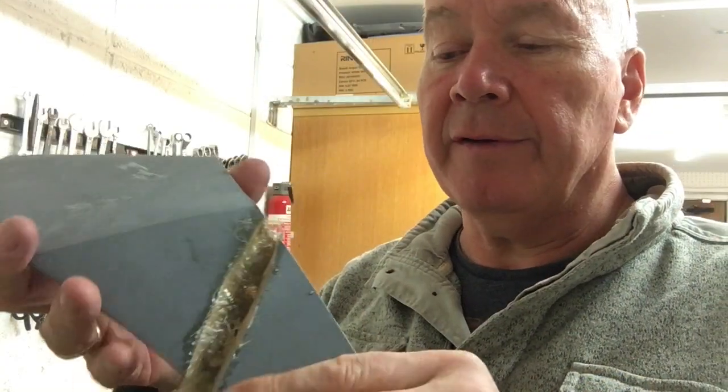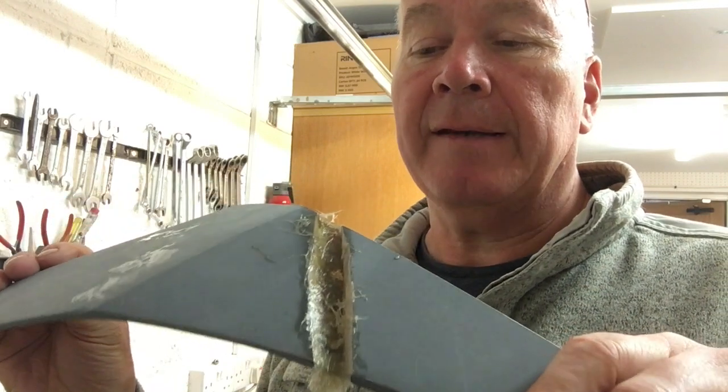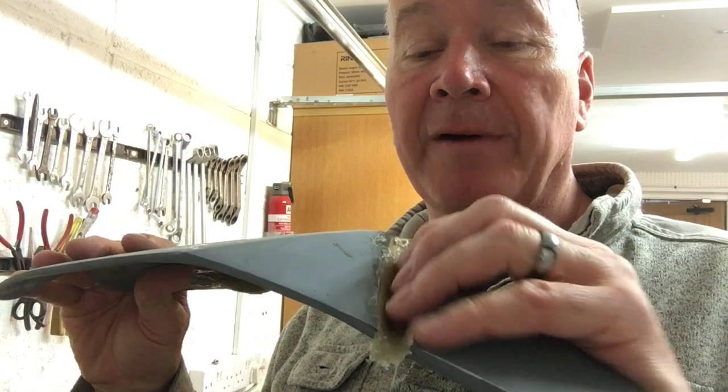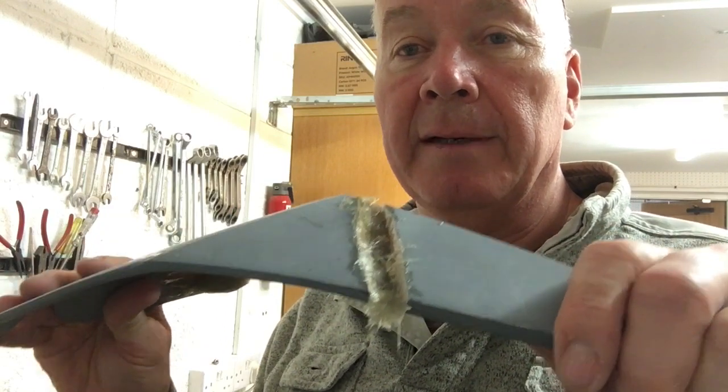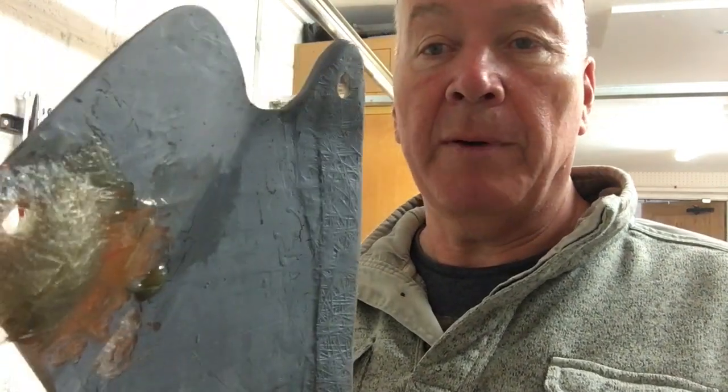Where that crack was, the filler was quite thick over the top of the fiberglass, it was always going to flex, it was always going to crack. So I've dug it out, laid in 3 layers of fiberglass. That's really strengthened that up now. Hopefully that shouldn't flex and shouldn't crack. Also, I've built up the corners so that I can get a nice flat mount to the stud. So I'm just going to cut those back, trim them up, clean them up, try them out.